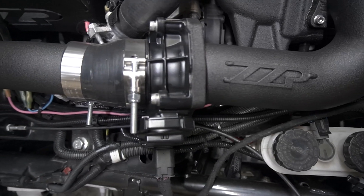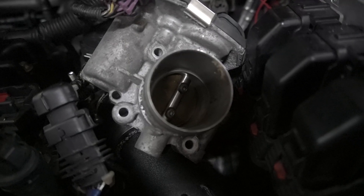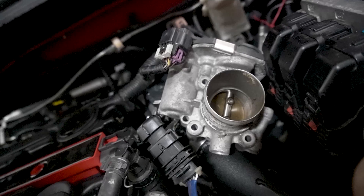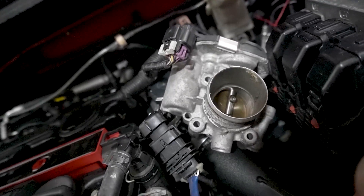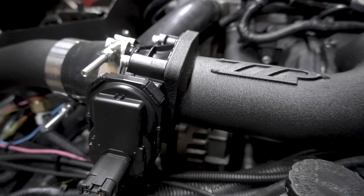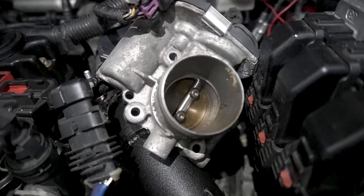Now with modern cars, most PCMs are torque-based, so they can actually limit how much throttle you're giving the car. They can also help you not stall the car — say in a manual car, if you let the clutch out too fast and don't give it enough throttle, the car will keep the throttle open so it doesn't stall itself. And if you're constantly going a hundred percent to zero percent throttle like driving aggressively, the car will modulate the throttle to keep things consistent.